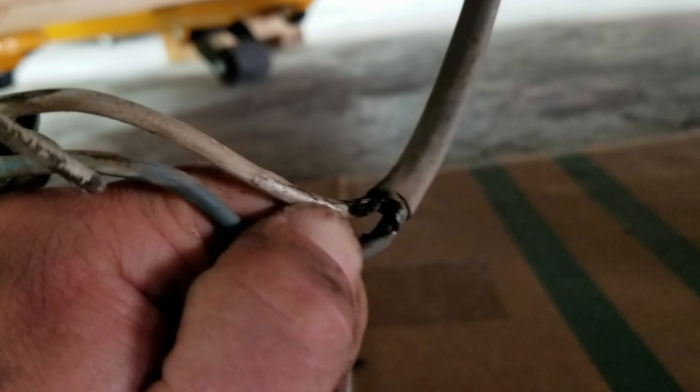Textbook shithouse faulty wiring — burns you and all your ancestors right to smithereens. You can see that, no doubt. Shorted right out on the frame. Just a little nick — whoever put this in gave it a little nick, just enough to open up the insulation, in the exact wrong spot.